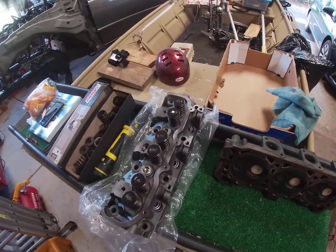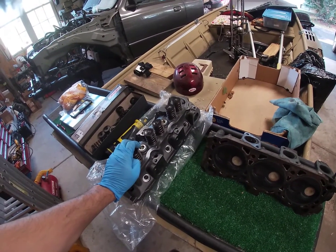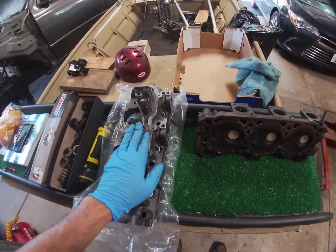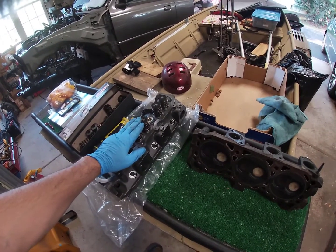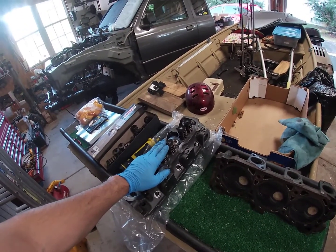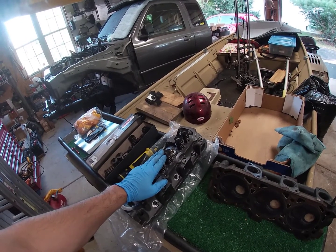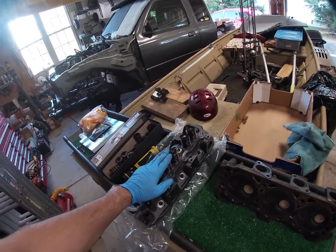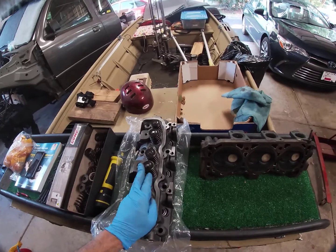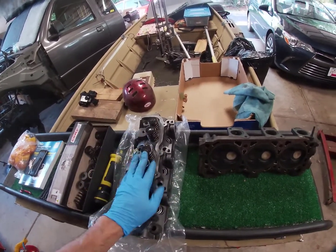You don't see too much information about this and what minimum needs to be changed in order to get the camshaft to work correctly with no issues. First and foremost, for both the 410 and the 422 camshaft, CompCams states you cannot reuse the valve springs or the push rods. With the 410 cam, people on forums say you can kind of get away with stock valve springs and push rods, but I do not agree with that. For the 422 camshaft you cannot do that, so either way changing the valve springs and push rods is a must, or else you'll be wasting your money on a camshaft.